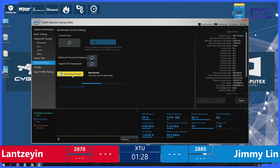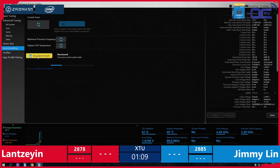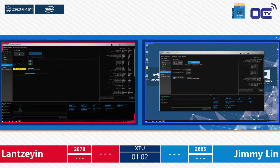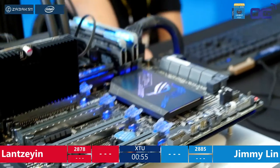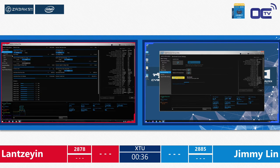A question on Twitch: what happens if you push too far? If you get random lockups, blue screens of death, or the system just reboots, you've pushed too far — back down and maybe increase the voltage. You always have to monitor three values: processor speed, safe operating temperature, and the voltage you give to the CPU. The motherboard itself has to be able to supply those voltage levels. Both players here on stage are using high-end platforms from MSI — the X99 Godlike Carbon Edition — and the ASUS Rampage 5 Edition 10, the latest motherboard from ASUS introduced here at Computex 2016.